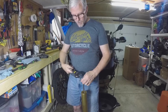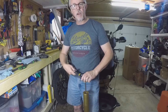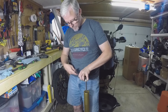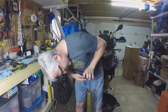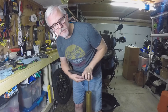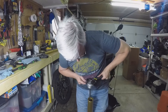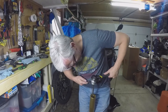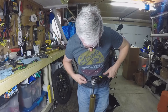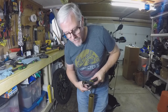I'm back with the wrench that I took the top off with, which is going to be my holder for this nut. I've got a 17mm wrench, which seems a little sloppy on this nut up underneath — it may be a 16 under tension. These guys actually loosened, as you would expect, looking from the top counter-clockwise — right-handed thread.